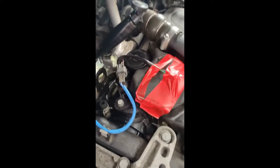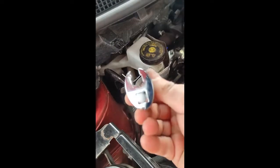I've had a bit of success. I've actually left this for a few days because I was fed up — I was driving it without the sensor attached, and when you drive it without the sensor all you get is a check pollution fault, but my cruise control works. What I've done is got my light in there — you can actually see the bolt now. I levered the tray away from the back of the engine, so now I can see the bolt from the top. I've put some WD-40 penetrant on it. I'd like to try and bend that metal heat tray back just a bit more to get a bit more access, because right now I can't actually get my crow's foot spanner on it.